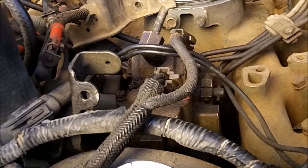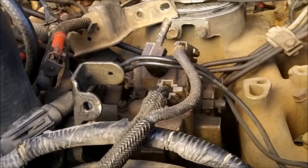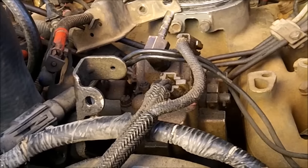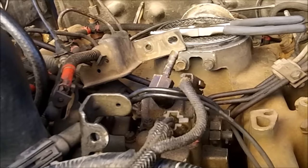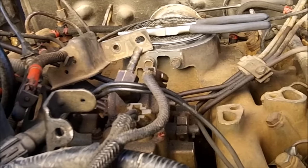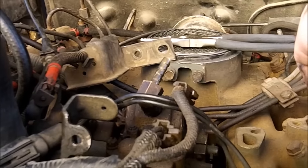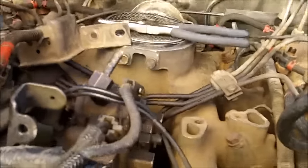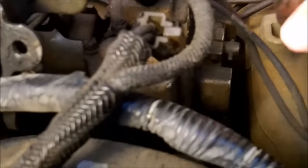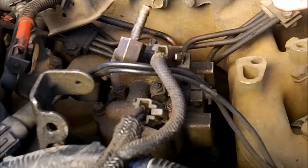Running the pump turned up three flats gives more power but it smokes pretty bad. The new one is at stock factory setting, but I plan on turning it up about two flats — since it's brand new it will still deliver more fuel than the worn-out old one. The old pump runs okay, but sometimes when it's cold you have to push the gas pedal to start it, and when warm it blows white-blue smoke from unburnt fuel because the injection pressure isn't high enough to atomize the fuel properly. It's not the head gaskets since there's no smell of coolant.